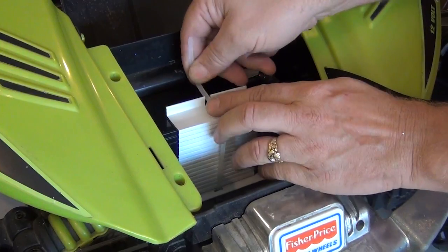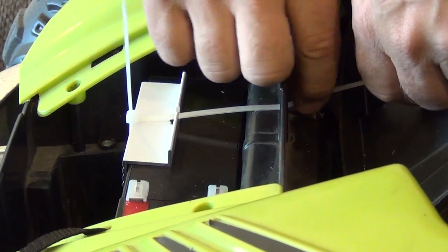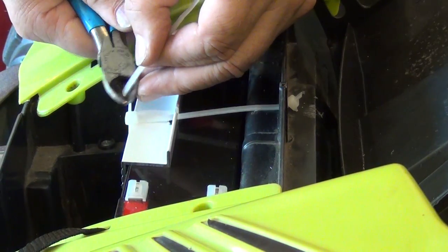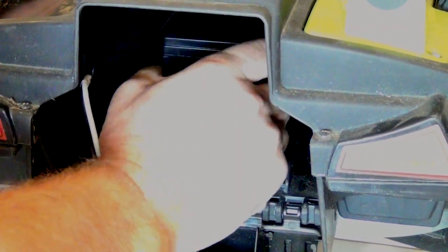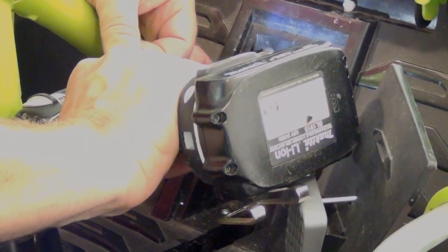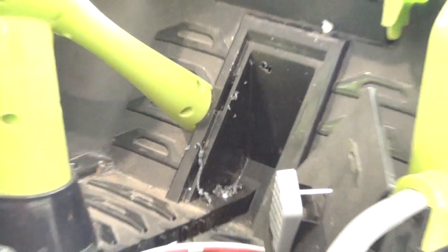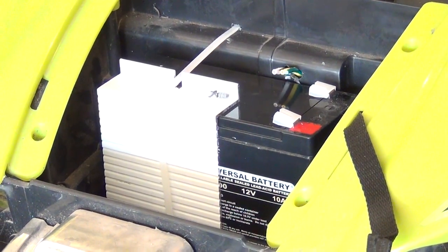The battery fits snug in the channels and is held in place with simple zip ties after cutting slots that I could feed them through in the battery tray and the Dune Racer body. The new battery also fits like a glove without any modifications to the rear compartment. I drilled a slot behind the throttle pedal for the new wiring harness. This area is double walled and needs to be slotted from both sides before wires can be fed through.